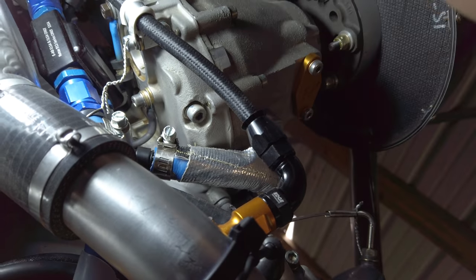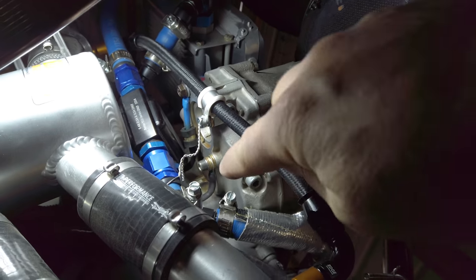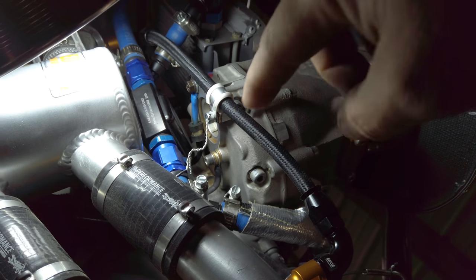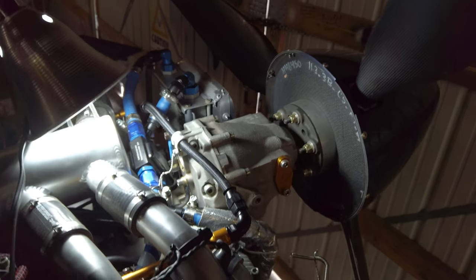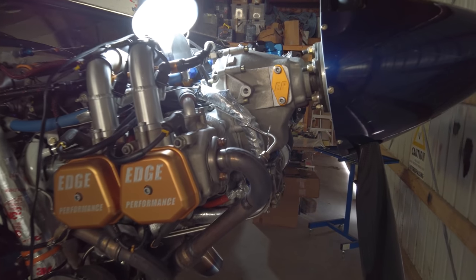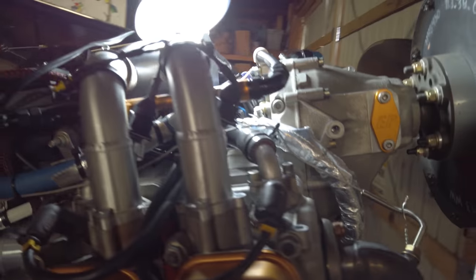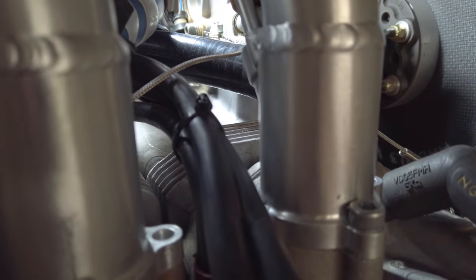But it's on the vertical part of this. It's not down on the flat part of the case. It's actually on the upright part of the case at the top of where that little gray line was. There's a hairline crack. You can't even see the crack, but when it's running, you can see oil actually bubbling out through that crack. And so, anyway, hey, you can kind of see it through there, kind of, sort of. But it's bad news.